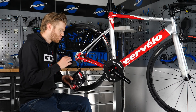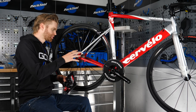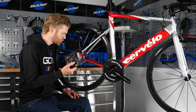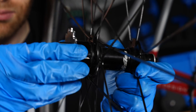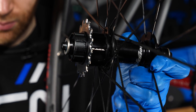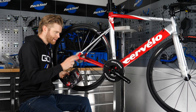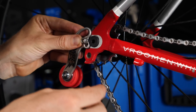Doing it this way won't make a fixed gear bike — it will be a single speed bike because you'll still be able to coast, as you've still got a free hub at the back. To do this, I've picked up a conversion kit. You can get these for about £15–20, probably about $20 in the States — not much money at all. They allow you to put a single cog on the back, and the kit also contains a little chain tensioner.